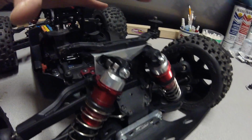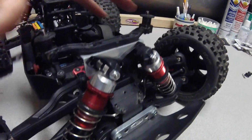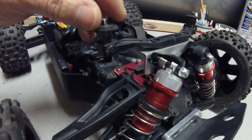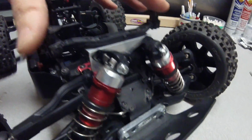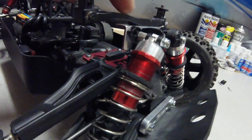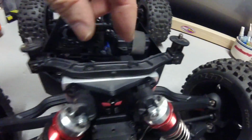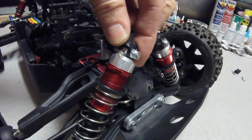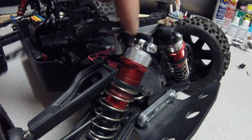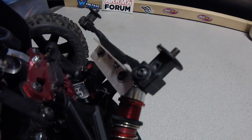Notice I did a little customization. This is the same type of bracket system I used on my Orange Darling, and it works killer just because these Proline slash body mounts have a ton of give, which is perfect for when you're having hard rolls or impacts. This is 1/2 inch by 3/4 inch angle aluminum, and then essentially you're drilling 2 holes through the top, and then I'm using Mitch Looper's M4 standoffs. These things are ultra beefcake, but essentially I just drill a hole so I can mount it through there as well. And hopefully that's getting a decent shot of the setup.